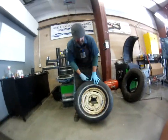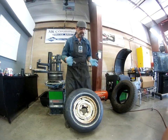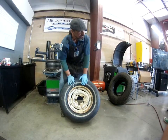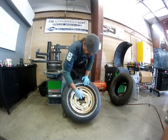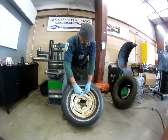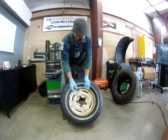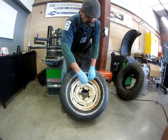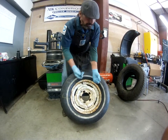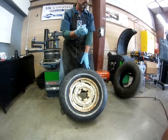What we're going to do first is let the air out of the tire. What I like to remind everybody to remember, there could be tire sensors here or there could be a tire sensor here. Some Fords have them located 180 degrees across, so just be aware that there could be tire sensors in here. I'm going to take this Schrader valve removal tool, put it in — lefty-loosey, or left takes it out — and we let the air out. Make sure you keep control of the Schrader valve because if you don't, you'll lose it.